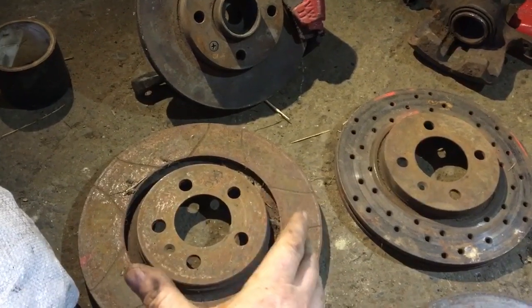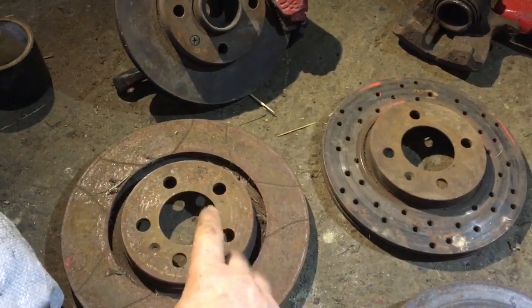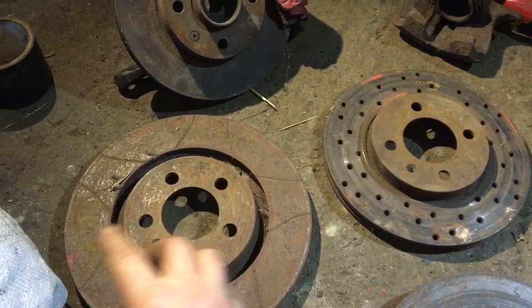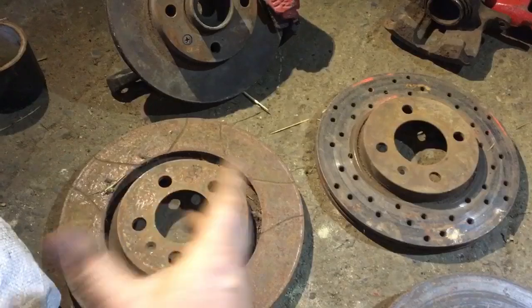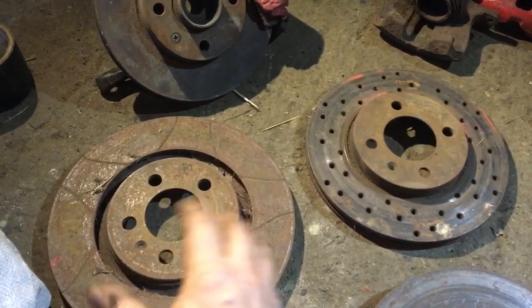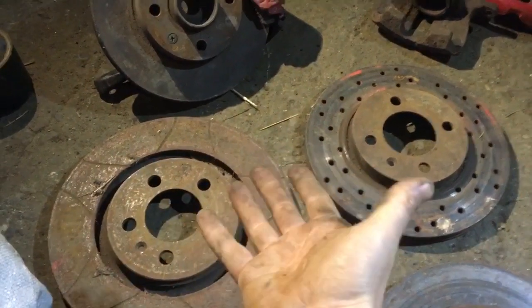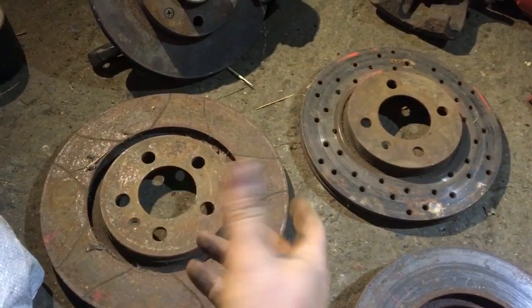The 280 is the G60 but it has four holes, while a VR6 will have five holes. The Corrado still had 280mm discs, and the Mark III Golf and that age group of VR6 came with 288 discs — just 8mm bigger, but not really noticeable.